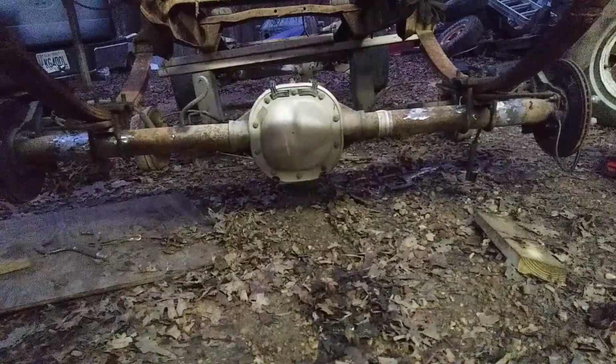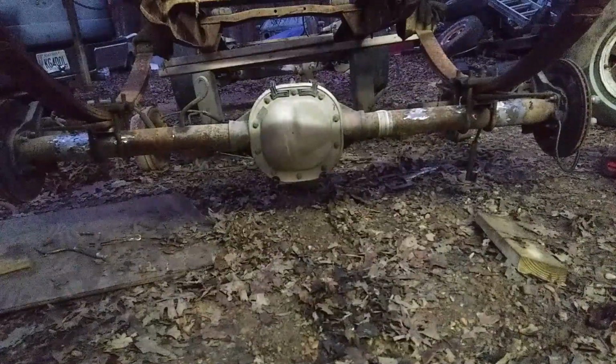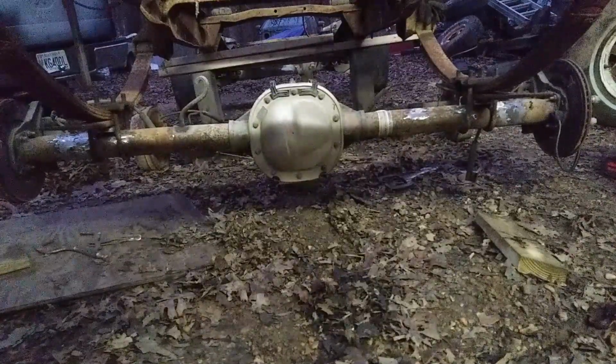But we're going to have to lower these springs. So probably what we'll do is we won't weld this thing. Probably what we'll do, just tack the perches, because we may have to grind them back loose once we lower. Once we get this thing lowered, we're going to have to cut them back loose again,